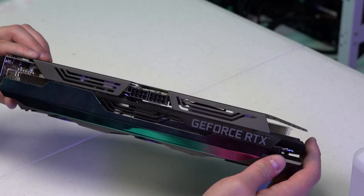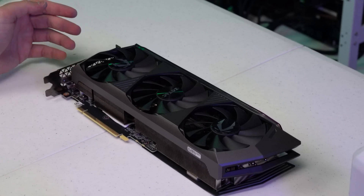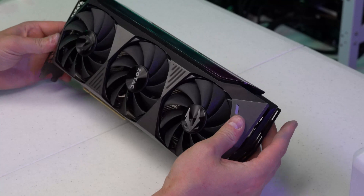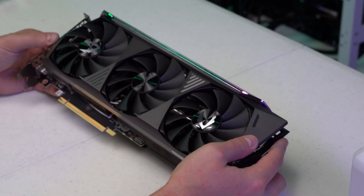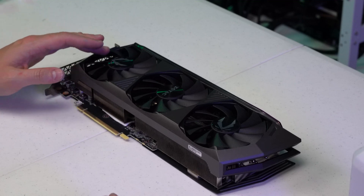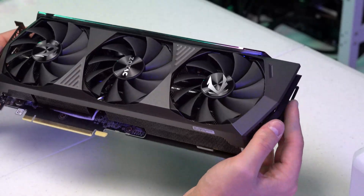If you want to get ahead of the game and not worry about it when the time comes, you can swap them out now. With the testing we have done it is fairly significant, especially on these 3070 Ti's. The 3090s had a junction temperature drop of 8 to 10 Celsius — that's on the Zotac Trinity editions, and those coolers are just very bad — but we did alleviate any thermal throttling on our six-card rigs. With other models like the ASUS TUF we do not currently have thermal throttling issues, so we are leaving those alone for now. These thermal pads really do increase the life of the card — the lower these things are operating, the longer they're going to last, the lower you'll have to push fan speeds, the longer the fans are going to last. I hope everyone watching this has a great rest of your day and we'll see you guys next time.